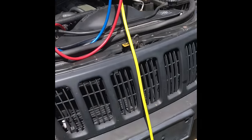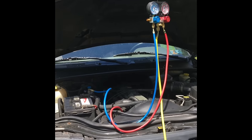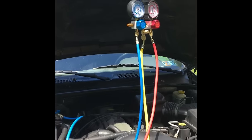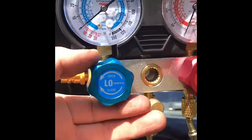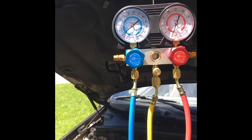We're going to evacuate the air out of the system. I took it to a shop to get the AC Freon evacuated so it was depressurized before I went in to do the work. I've done a lot of stuff with this Jeep but never AC work — so this should be fun. To start, all your knobs — your low side and high side — are closed, and your couplers on the low and high side service ports are closed. Counterclockwise is closed on the couplers, clockwise on the manifold. We'll draw a vacuum for about 35–40 minutes to get all the air and moisture out, then recharge the system.